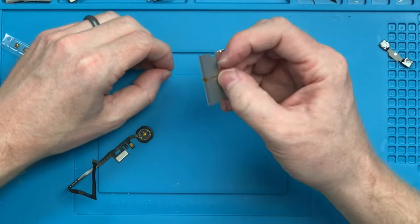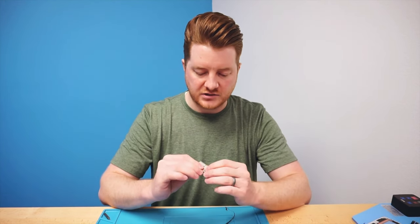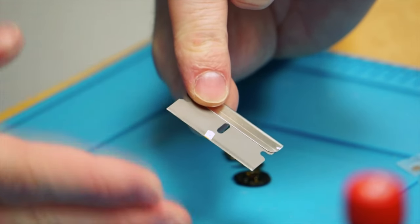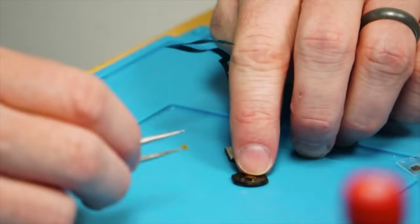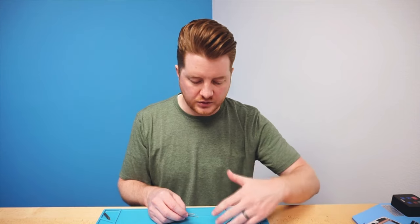It's kind of tedious but you'll be able to pull off the entire piece if you are very careful. It's actually pretty difficult to do — you may need to use your microscope if you've never done this before. We had done this for years before we had a microscope, so it's doable without one. What you're going to be left with is just the little piece of Kapton tape and the black dot. Grab that with your tweezers. Apply a little bit of primer to the backside of the home button and clean off any remaining black nub. If you have any of the black nub left on there, use a screwdriver to lightly scrape it off and clean it with some alcohol — you don't want to flood it because it could cause the Kapton tape on the original home button to fall off.